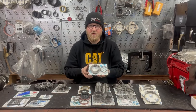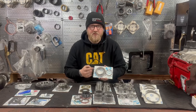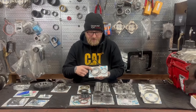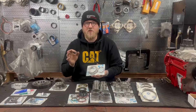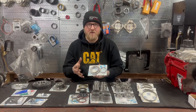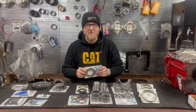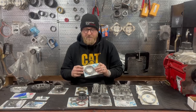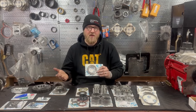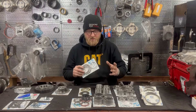Another really important component that's not included in most rebuild kits is a shim kit. This includes a main shaft shim kit, a counter shaft shim kit, and a reverse counter shaft shim kit. You have to set all your clearances, and it's absolutely critical to getting a quality rebuild. If you don't shim and check your end play and clearances, your transmission will not last very long — I can't overstate how critical it is. Most guys bypass it because they don't realize shims don't come in another kit, and they don't want the truck down for a week and a half to order a new set. So this is coming with the kit, and the video we did with Torque King will show you how to do that as well.